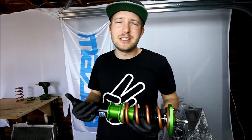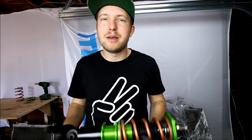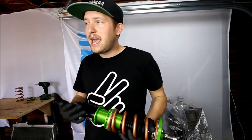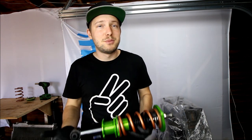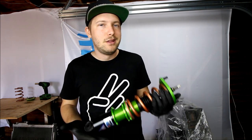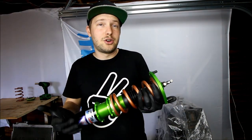Having several sets on my 300ZXs and really liking them, when I got a Miata I hit up Powertricks and asked if they could build me a set — at the time they didn't offer any. They actually did it, I bought them, put them on the car, and they were okay. I hit up Powertricks again and said I like the coilovers, but here's what you could do to make them better. They were receptive to my feedback — I gave suggestions on the spring rates, spring length, and cup style. They made the changes, I put them back on, and I absolutely loved them. That set I just pulled off has 55,000 miles on it, doesn't leak, no issues. I think they're a great combo for being able to track but still daily driving the car.